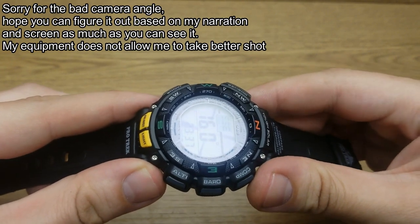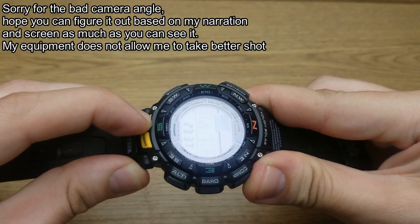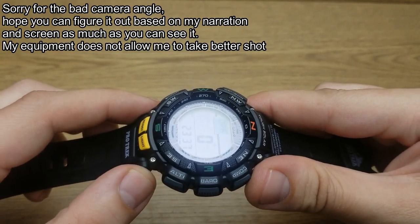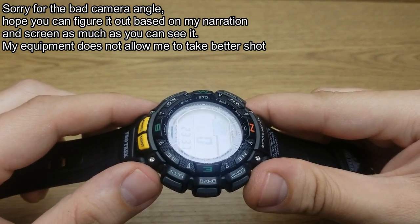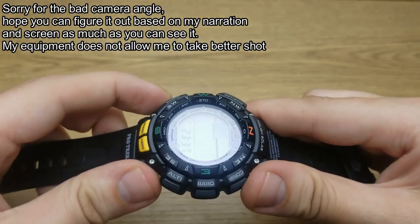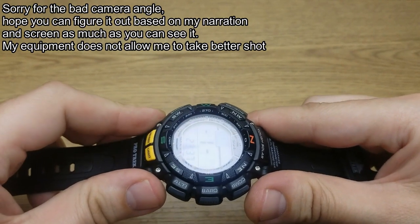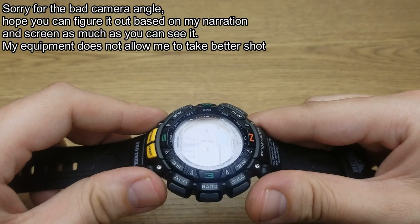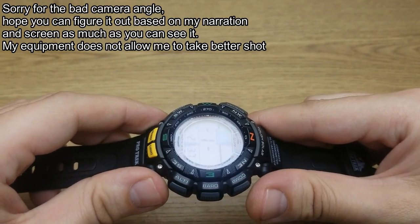In the digital compass mode, press and hold the adjust button until SET HOLD appears and disappears with a beep. Over here we have the current declination settings. Now, what is next to do? Well, it's to press the mode button, and at this time, 1 is indicated and the 12 o'clock pointer is flashing. This indicates that the watch is ready to calibrate in the first direction.